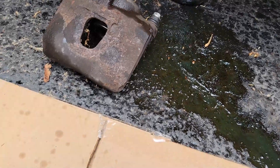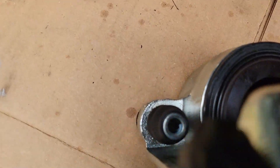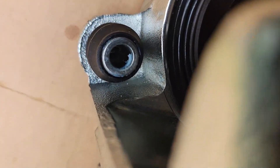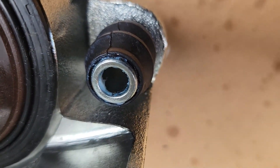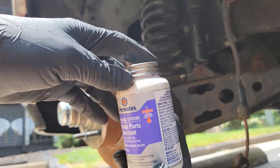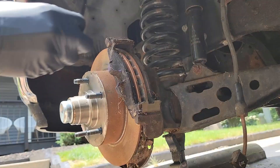Now let's check out the new caliper. This one came with new boots and what's even better is the manufacturer also greases the hole where the bolts go through. If yours isn't greased you need to do it. Some people will reuse their boots, but these are so cheap it just makes sense to replace them with the new ones. I'm going to add some more brake lubricant to the back of the brake pads and then start putting it all back together.